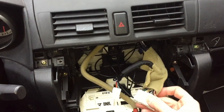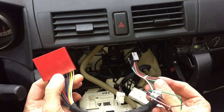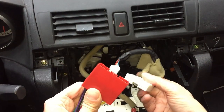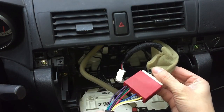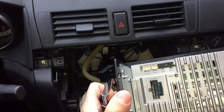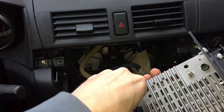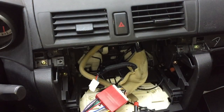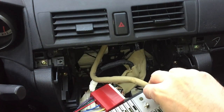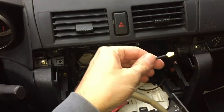Now we can install the radio itself. I have an adapter harness I found on eBay to connect to the original Mazda harness — so you don't have to cut any wires. You connect the adapter harness with the small harness that comes with your radio, then plug it into the original harness, with the other end connecting to your radio. This is really safe. If you need the diagram for the pinouts of the original harness, I have a link down below where you can download the document.